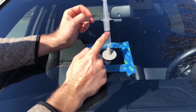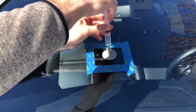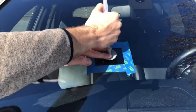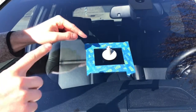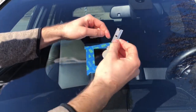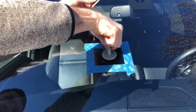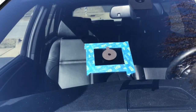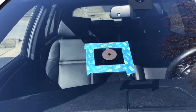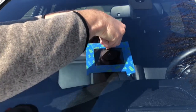It's been about 25 minutes. Hold down on the pedestal with one hand and with the other hand pull out the syringe from the pedestal. Now slowly start removing the pedestal — you can use your finger or a blade knife; just take it easy with the blade, don't cut yourself and don't scratch the windshield. Next, peel the adhesive tape. You might see a little resin drip down — it's okay; take a microfiber towel and wipe it down slowly and nicely.